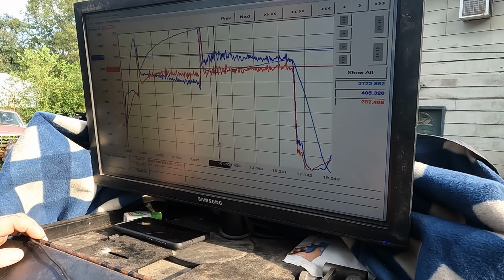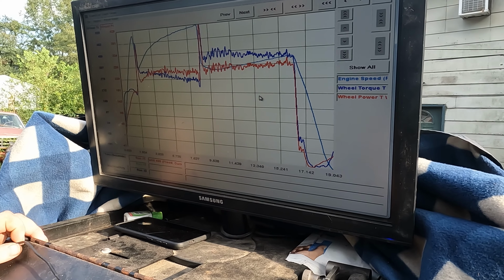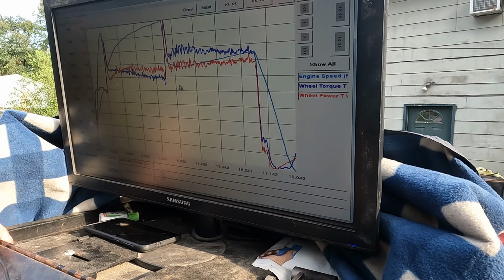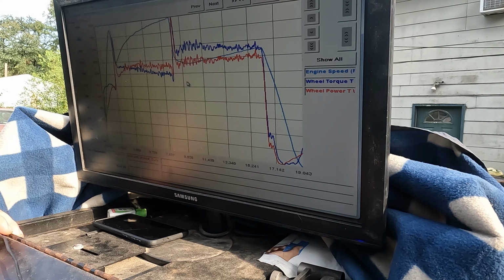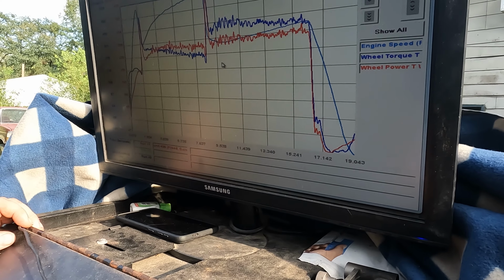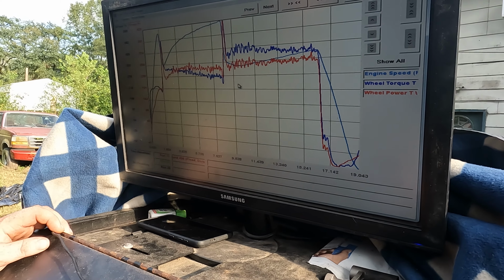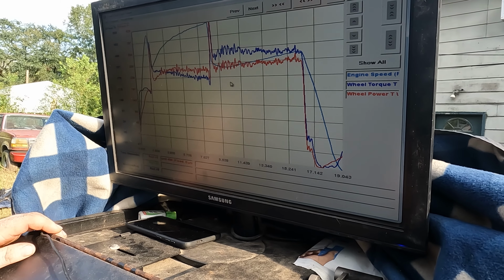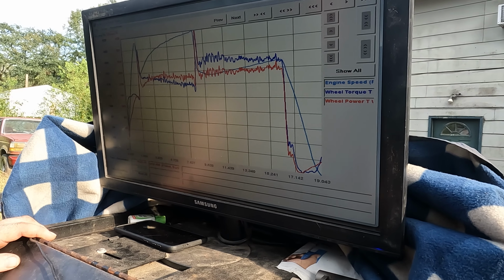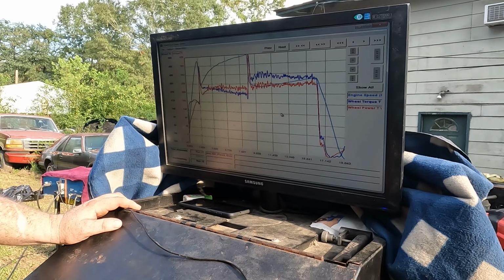It sounded healthy, working hard. Yeah, I mean, you might have to look at the timing thing, right? Because I know, like, when I put advanced 4 degrees at, you know, below 4,000 RPM, it does feel faster. So it might smooth that out. I might. I don't know, play with it. Yeah. See what it does. I'll play with it to get it where I think it feels good, and I'll come back and we'll do it again. Okay, that sounds good.